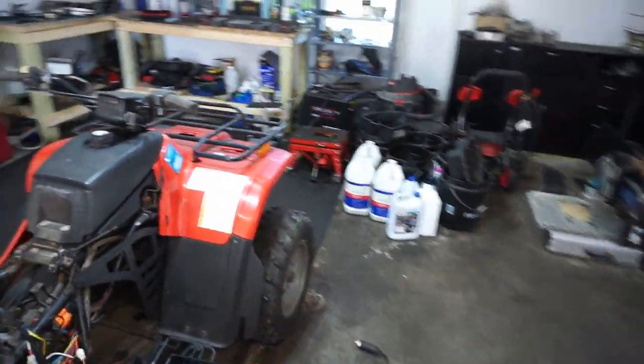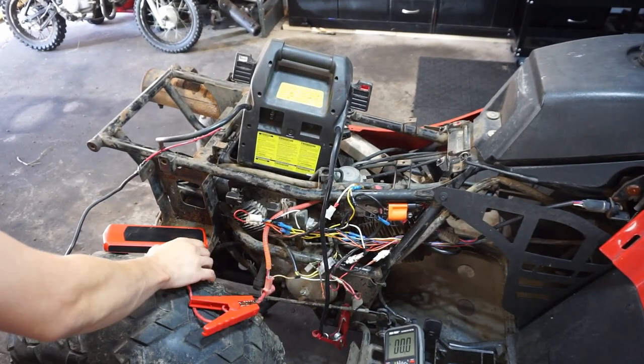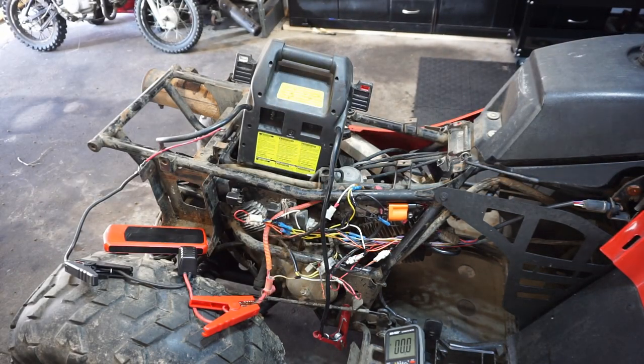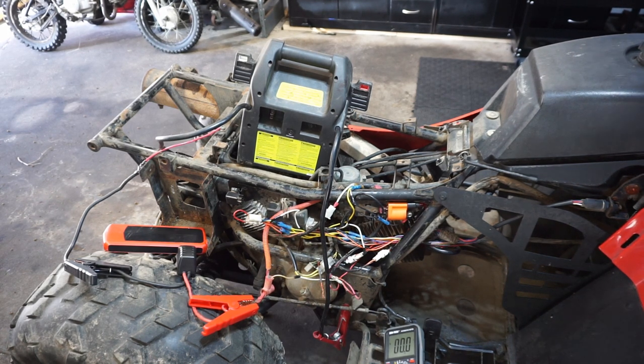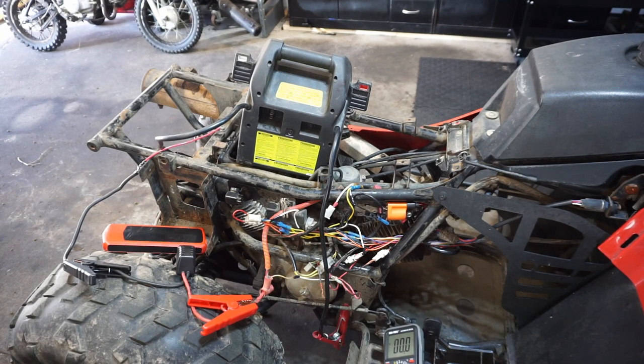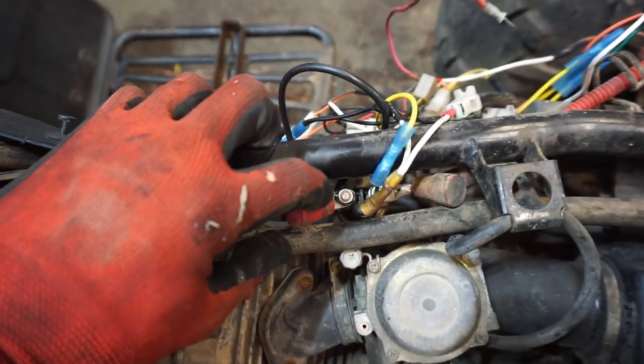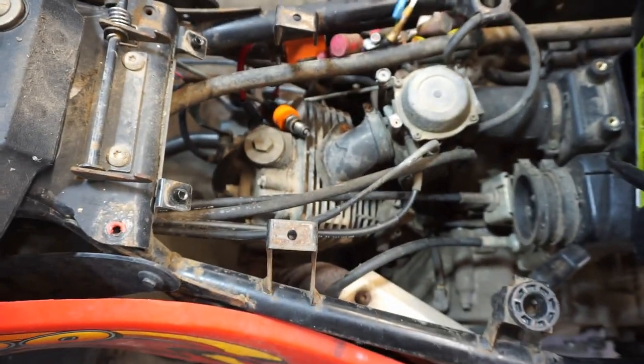Alright, nothing is working on this thing, but I just connected it manually. Check this out. Turn it on, and the engine should spin over. Nope. Solenoid just clicking. It's weird. And no power. I don't know. Very weird. We're getting enough power to the solenoid. It's just not turning it over. So we're getting 14 volts to the solenoid. I checked it with the voltmeter at this terminal going down to the starter, so I think the starter's crap on this thing.